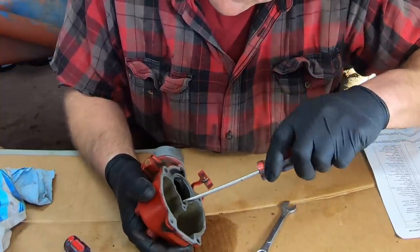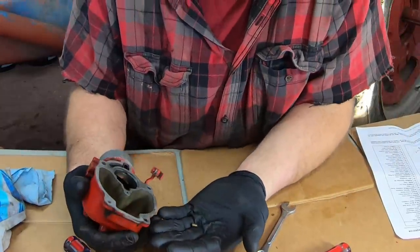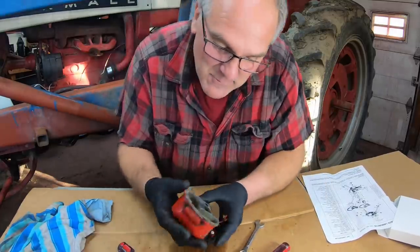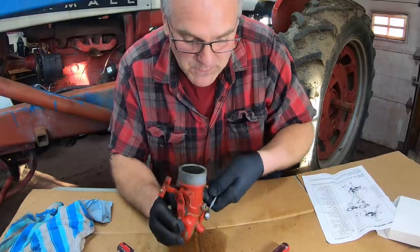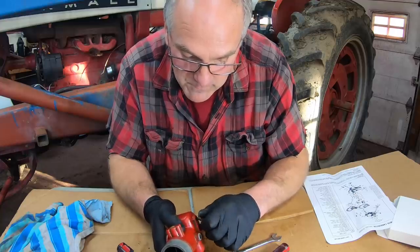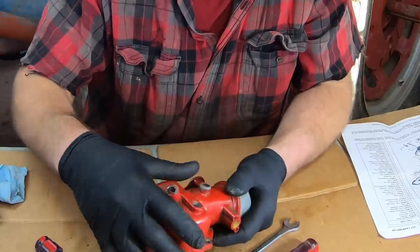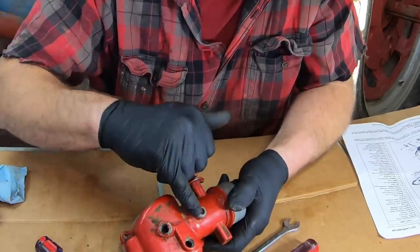Next, while we're in here, we'll take out this little plug, which I think is just access to a passage. And then I've got a little plug at the bottom — that's a bowl drain plug, for if you ever have to drain the bowl. We've got all the bowl stripped off now. This is a drain here for when the carburetor floods — it's a copper mesh screen. They can just stay in here, that's no big deal.